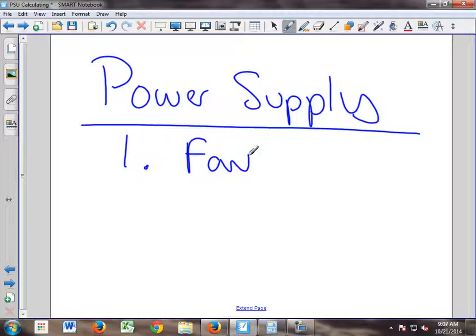Do all computers turn them off now by themselves? Well, there are two different turnoffs we're talking about here. You're talking about when the CPU overheats and when the power supply overheats. CPUs, when they get hot, will slow down, turn off. A power supply, when it overheats, it just turns off. Okay? So that's the first thing I will notice on one that's going bad usually, is the fan isn't spinning.